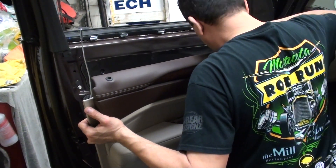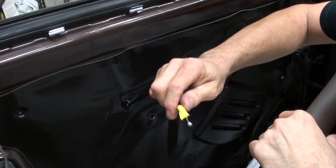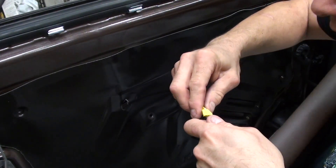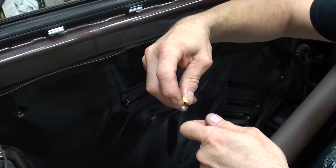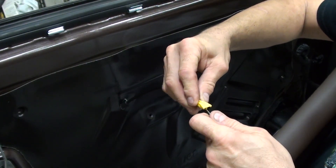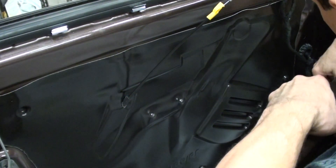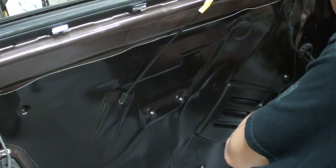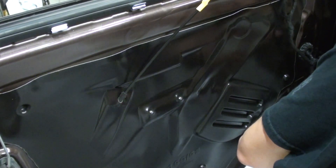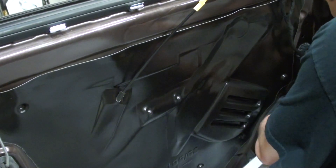On the back side of this, the door has a little yellow setup here for the actual handle. What you want to do is pick up that little yellow piece and then slide it out, and then you pull the little ball off the little mechanism that's in here. The actual panel has two clips that have been pushed in, and I'll show you that in a minute.